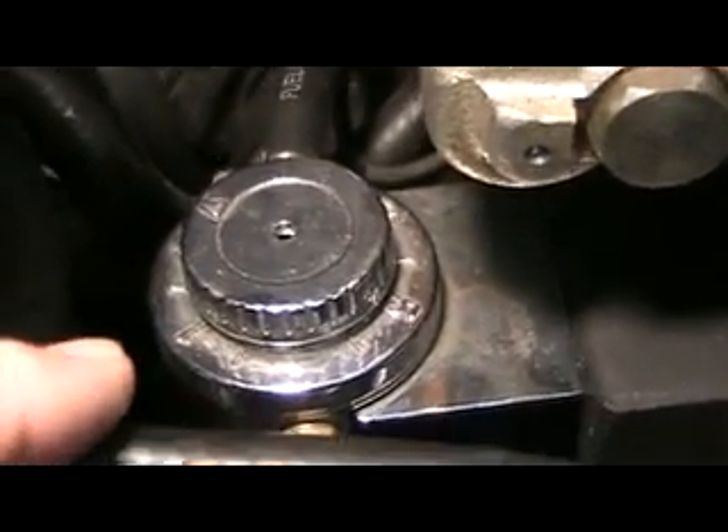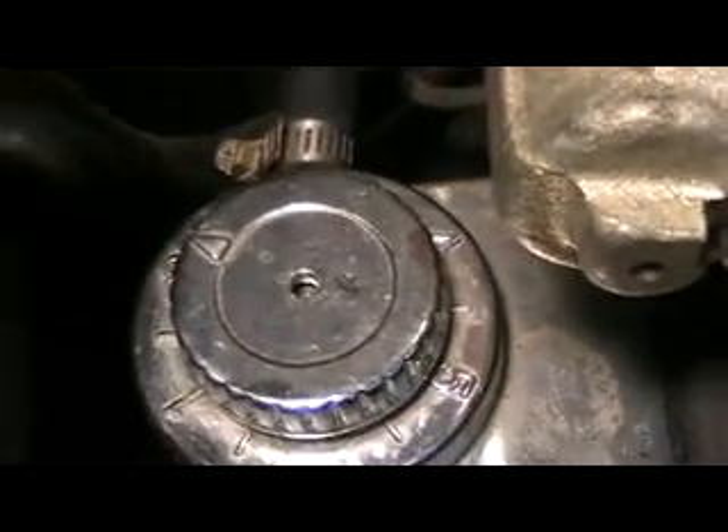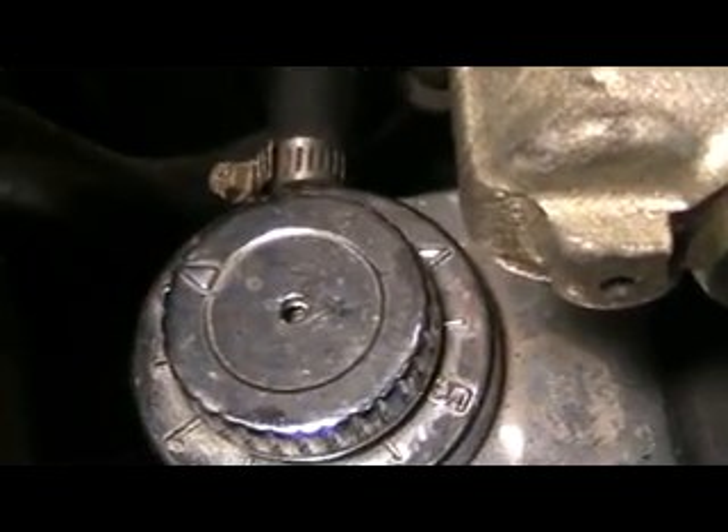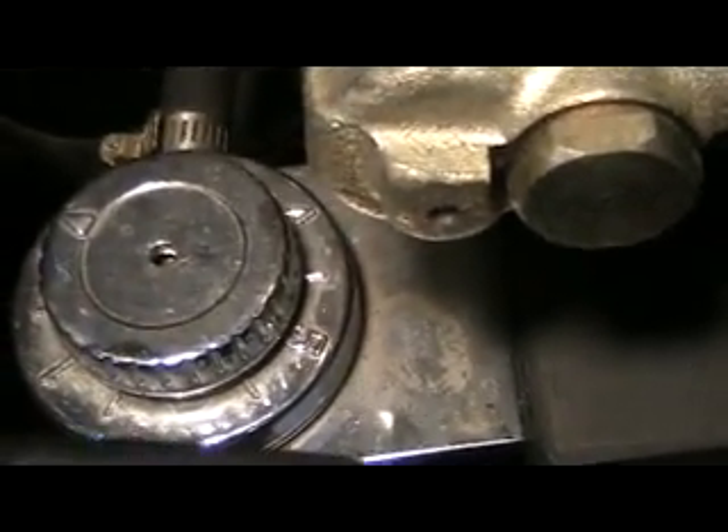It's not friendly to the carburetors of old — the carburetors with the floats and needle valves. They like the European ones, the MGBs and those; they like three pounds or less. This is dialed — it has a little dial on top here. You can see the arrow there. It's a little higher than nine o'clock. That arrow is pointed at a digit around the perimeter of number two, so it's set at approximately two pounds of pressure. And this engine runs fine with that setting. Now I know I'm not pushing too much fuel into the carburetor system.